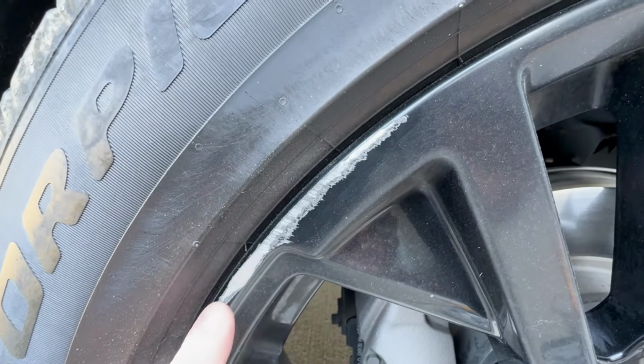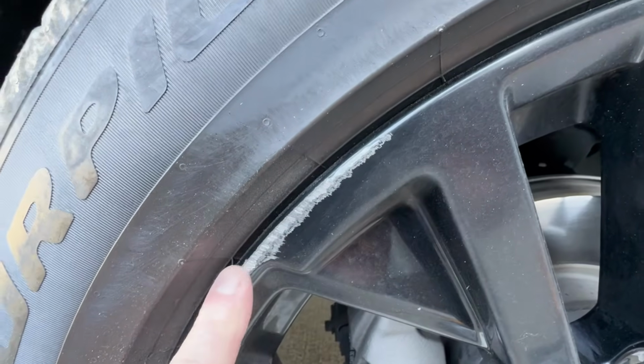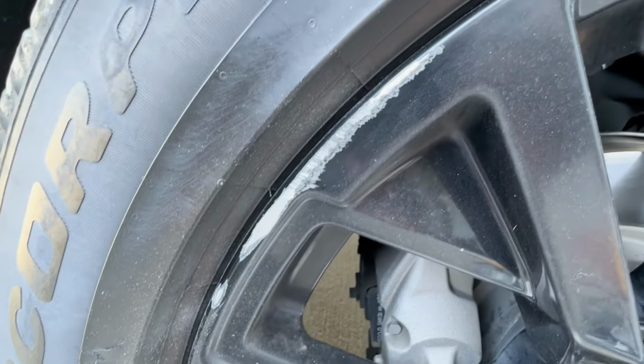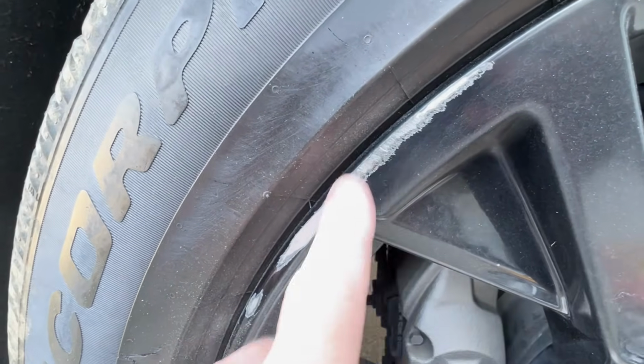And so what we're gonna do is we're just gonna smooth it down to the metal and be careful with kind of smoothing things out. And then what we'll do is we'll go ahead and I'll show you how to paint it. But well, first we gotta make it nice and smooth and get rid of all this roughed edge. So how I'm gonna do that is I'm just gonna use my Dremel, and I'm just gonna get a sandpaper. This is a pretty heavy grit sandpaper, just go on my Dremel tool. And I'm just gonna kind of turn the RPMs down just a little bit, and I'm gonna start off just seeing if I can get it a little bit smoother, and then I'll probably go to a finer grit just to get it nice and smooth, and then just use some regular sandpaper, and then we'll get it kind of prepped and ready for the paint.